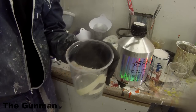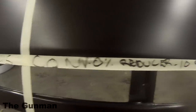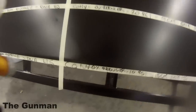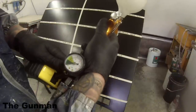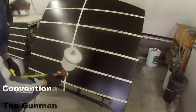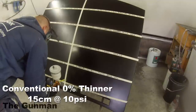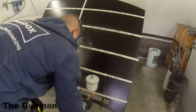I've squared off this bonnet and I'm going to do loads of different settings. I'm doing different distances and air pressures — I hope you guys appreciate this video because it took a hell of a lot longer than most to make. I had to brainstorm it; it's basically like doing a science project. I'm starting off with zero percent thinner, conventional spray gun, 15 centimeter distance at 10 psi.